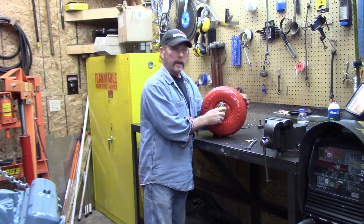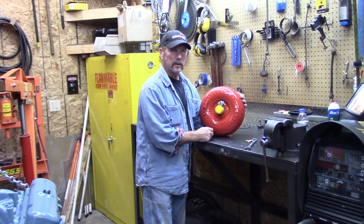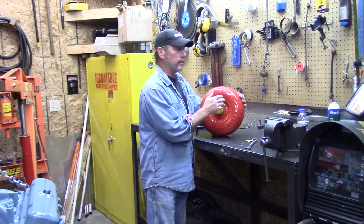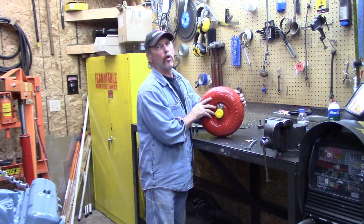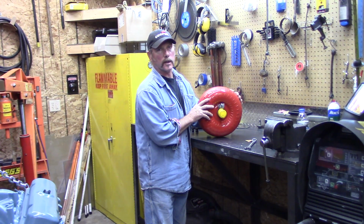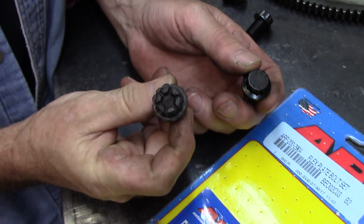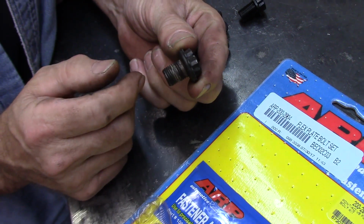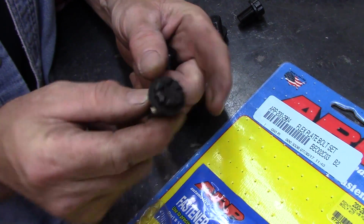Hopefully. When it came to the torque converter, we went back to our friends at Hughes and described what we had, and they made a fully furnace brazed, fins on this. It's going to be overkill for this street car, and it should engage at about 2,000 RPM. So any Pontiac guru would probably recognize these, or if you work on GM, this is the stock bolt that holds the flex plate to the back of the crankshaft. It's got a bunch of serrations, grade 8.